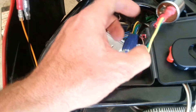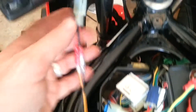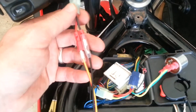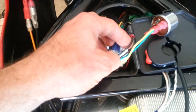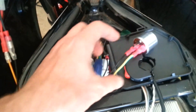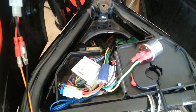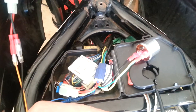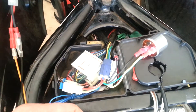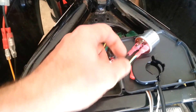Those are those two black ones there. We have one coming from the 12 volt going up to one side of the switch — there's the clutch switch — so it comes through that switch via a little adapter, and comes back to a flasher relay. I need the flasher relay because the flasher relay that normally drives the indicators is actually buried back in the bike. The bike starts, supplies power to the flasher relay, that goes through the switch, and then the switch goes to the lights. Rather than run a bunch of wires all the way back to the bike, I decided I'll just put a new relay in here.